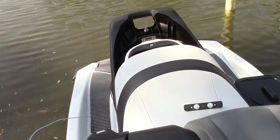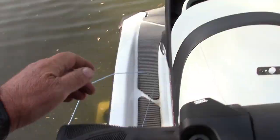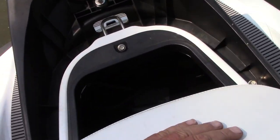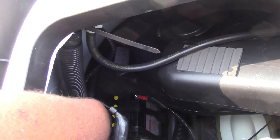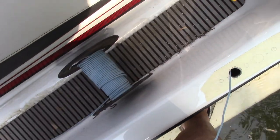So what you have to do is — this is a hollow channel. If you go all the way to the back of the ski and look in there — can't see it on the camera — but if I reach my hand all the way down in there, you can feel the void where the end of the channel is. So what I did was get a piece of number 12 building wire, and I shoved it in there and it went all the way to the back, and from there I tied a string on, and I'm going to pull the string out right now.